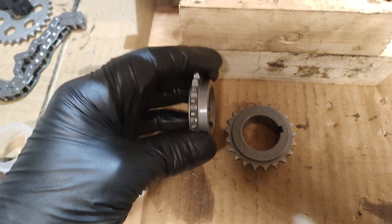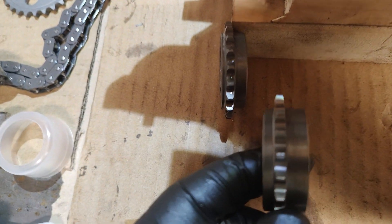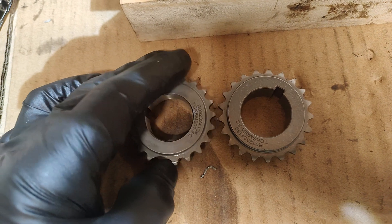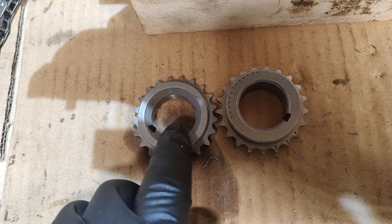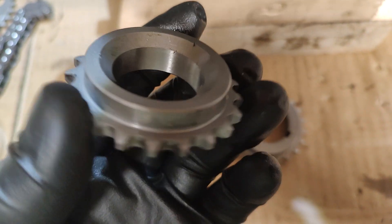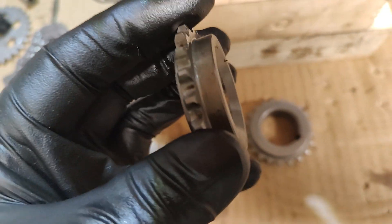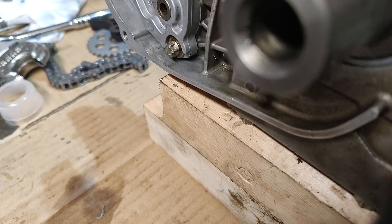The one to note is the thinner of the two sprockets. There's a thick sprocket and a thin sprocket. They both look the same on one side - they've got serial numbers on them. But turn them over and you'll see one's a flat sprocket and one's chamfered. The oil pump sprocket is chamfered even though it's got a slot for a Woodruff key - it could be a sprocket from another model that they've just used.